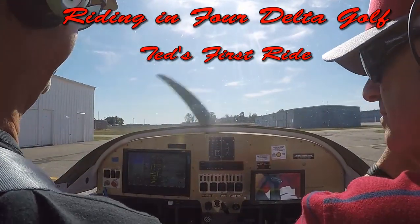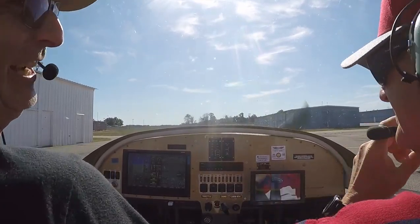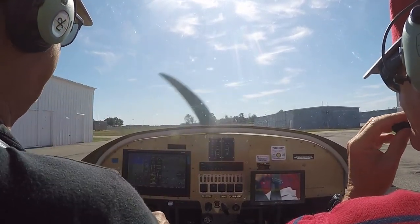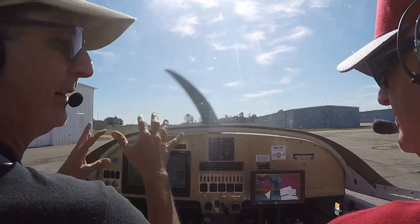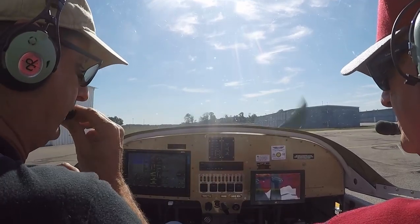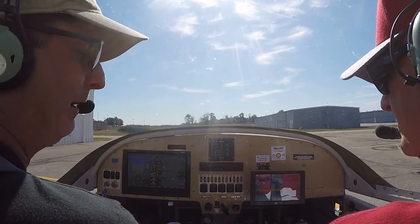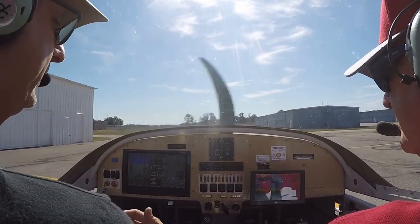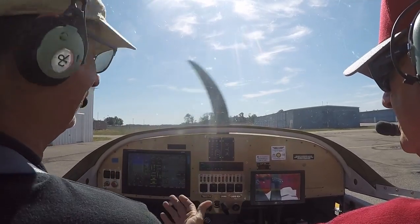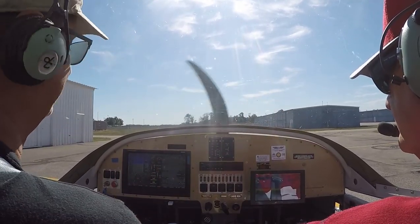Watch the language so I don't have to cut it out later — I don't have an adult YouTube channel. So one thing we have to do: that engine is made out of all kinds of dissimilar metals, so they're all going to expand at a different rate. Before you put on a whole bunch of power, you want everything to be fully expanded or you're doing long-term damage. You want to treat an expensive engine as if it's an expensive engine.